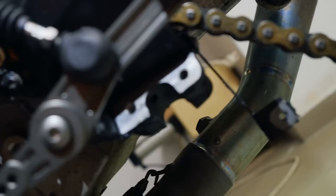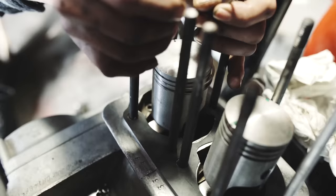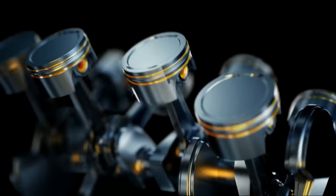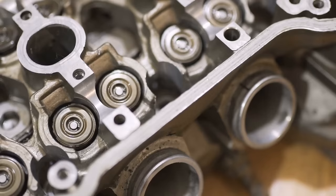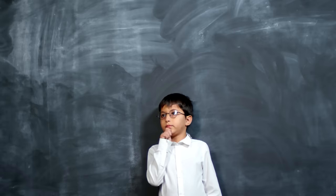Breaking in a motorcycle can refer to multiple components or systems, but the most important part to consider is how to break in a new motorcycle's engine. Engine break-in is the process in which piston rings become properly seated against the cylinder walls. This involves scoring the walls in a way that matches the most minute characteristics of the piston rings, allowing them to create an optimal seal between piston ring and cylinder wall. An ideal seal ensures engine longevity, no loss in compression, and no increased oil consumption.